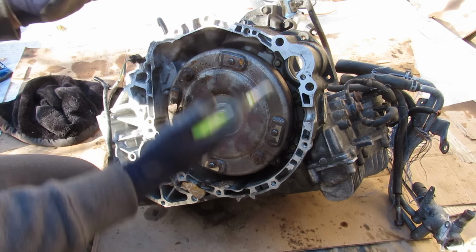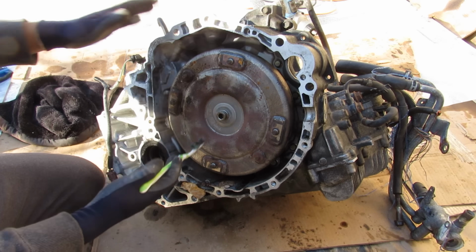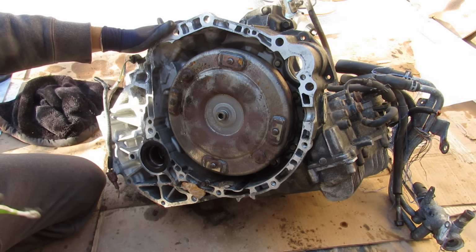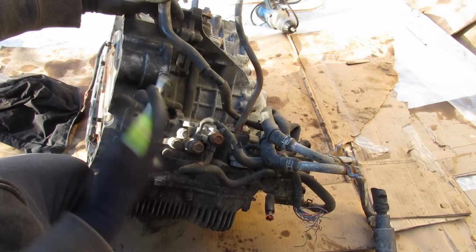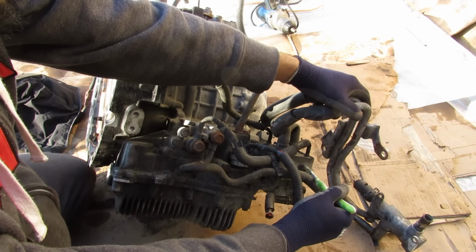Now if we start by taking an overall look around this transmission, at the front here we've got a traditional torque converter just like in a regular automatic transmission. And I've got another video on how torque converters work, so make sure you check that out in the description below. Now this transmission comes out of a Nissan Murano, which means that it's actually a transaxle situated transversely for front wheel drive. Appropriately so, we do have a transmission cooler located over here.